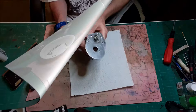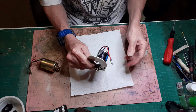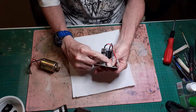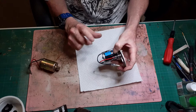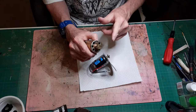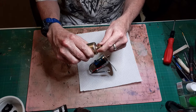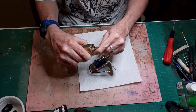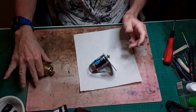New motor is mounted and it looks awesome. If the performance is anywhere near as good as what it looks, we're going to be in business. I've also decided to change the pinion gear - this is the one from the original motor. It's either 23 or 25 tooth, I can't quite remember, and it's not actually listed in the instruction manual - it just gives a part number without saying what it is.